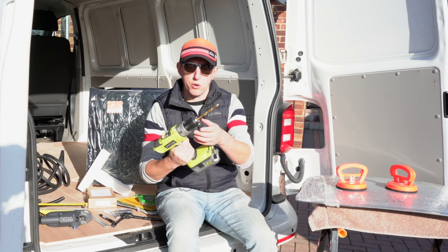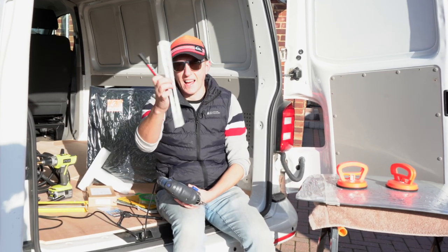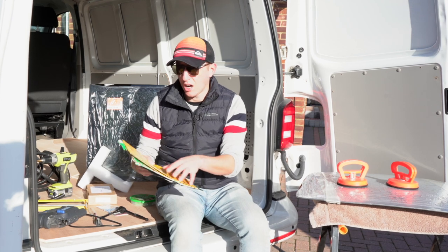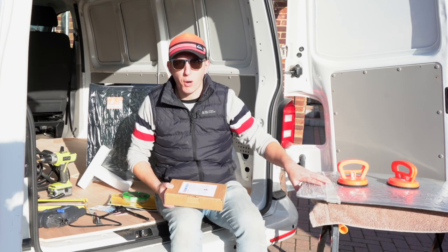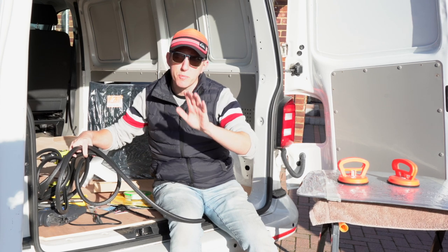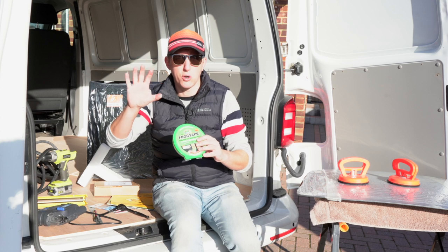You're going to need an electric drill with a 10mm metal drill bit for making the holes through the panel, and a jigsaw or nibbler with a decent metal blade. You'll need a marker pen and ruler to measure. Disconnect the battery before any cutting or drilling — I've already done that using a 10mm socket. I've got aluminium oxide sandpaper in 60, 120 and 180 grit for prepping the surface. The windows from Heritage Park Centre come with a fitting kit including bonding sealant, etching primer and protective gloves. You'll also need rubber trim for the cut edges, a mastic gun for bonding the windows, and frog tape or masking tape to hold the windows in place.